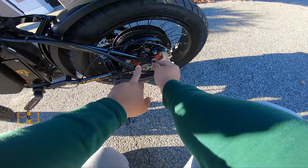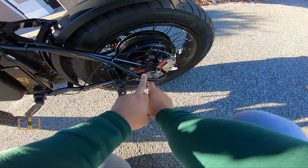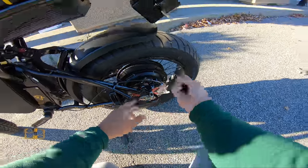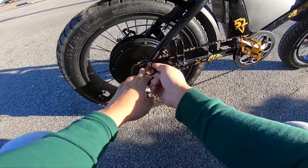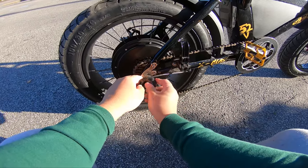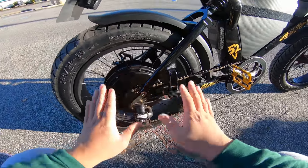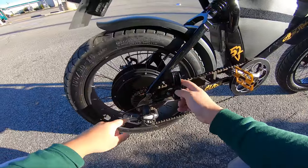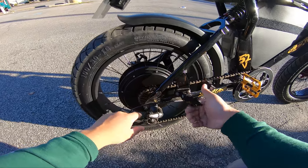What we did was we created a two torque arm setup on each side. We have the main bolt here, one torque arm situated here, and then another one here — this acts as a support, so it's almost like a three-way torque arm situation. Same thing on the other side — slightly different, with dropout holes on both sides, all coupled with the main bolt. It was a combination of three torque arms to really keep this thing secure, preventing the wheel from spinning out or cutting the motor wire. If you're upgrading to the 5000 watt kit, definitely inquire about the double torque arm setup — highly recommended.